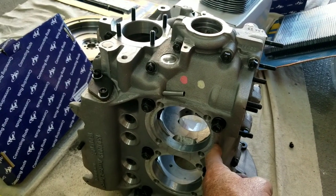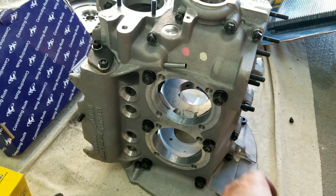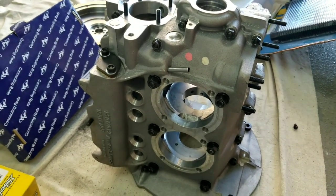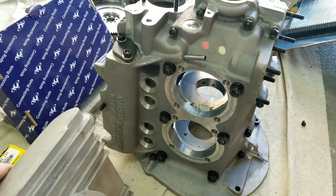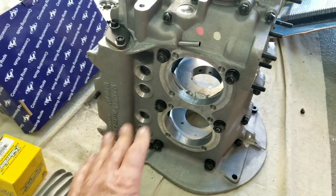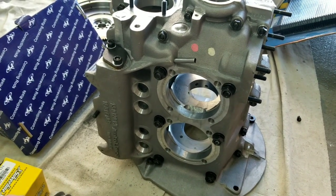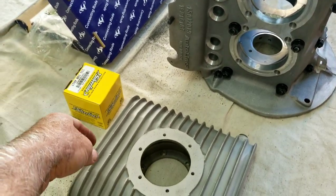You want to make sure you don't have to double shim — you may have to have an additional shim on there to make up for that step. You're going to have to check all your cylinders and make sure they're all the same deck height. We're going to have a motor build coming up, so it will help you guys who have never maybe built a motor to learn how to do it the right way. Also, VW Darren does a lot of cool motor builds and will walk you through it pretty well — check out his channel.